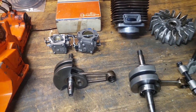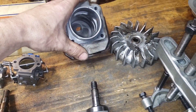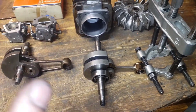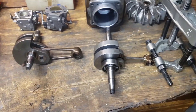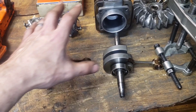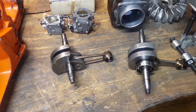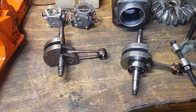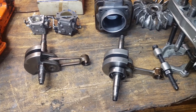The cylinder, the cranks, and the flywheel are all getting sent out to an outfit in Arizona. They're going to split the cranks and switch the connecting rods. Some people comment like, 'That's not going to fit in there' — yes, that's kind of the point. I know that an 084 crank doesn't just drop in; it's a little more involved than that, but there's some method to my madness.